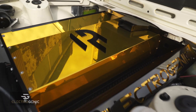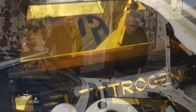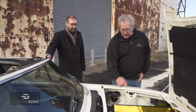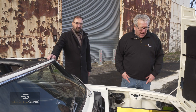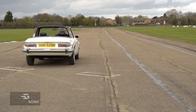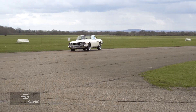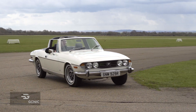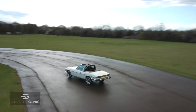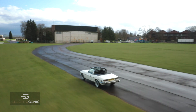This is obviously a bright and gaudy color, a bit like myself. And in here we've got four batteries — one either side, two in the middle — and underneath there is a Hyper 9. We've kept all the original features. It's got power-assisted brakes and power-assisted steering. We've replaced the engine that's famous — or infamous — for being not particularly reliable, and replaced it with an incredibly reliable Hyper 9 electric unit.